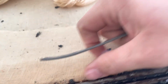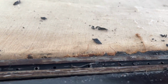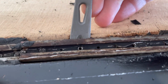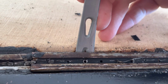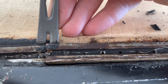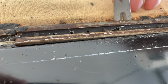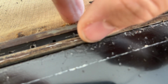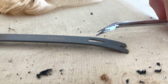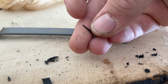I started right here. I got the sealant off this top fabric. Then I used this side here that was not dirty before, and I carefully went underneath. Here was the tack, right? Carefully went under here, lifted. Two tacks right here, lift, and lift. And I went down to here, lift, where I just removed that one. It lifted it up enough so I can push down, and the tack head was accessible with this tool that I modified, which allows me to pull out these tacks.